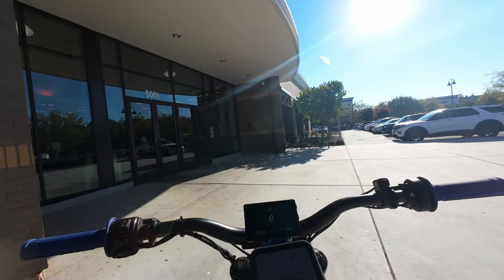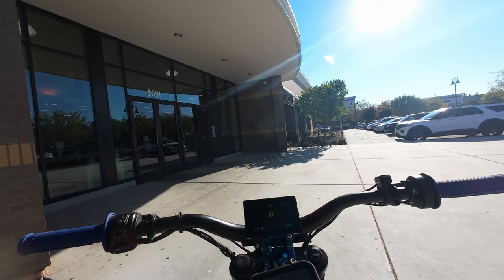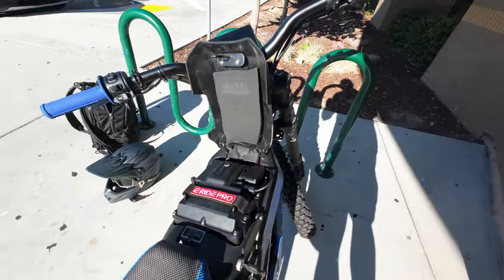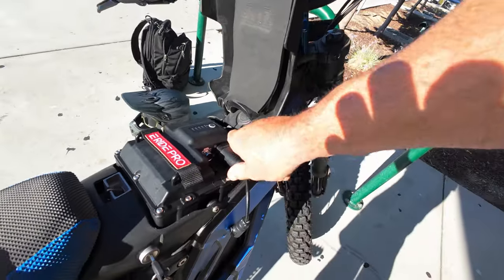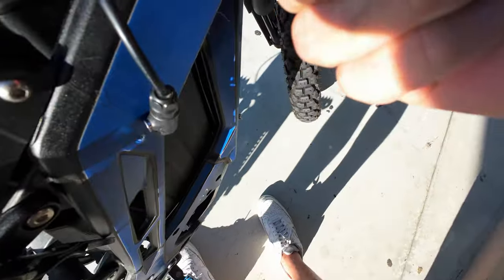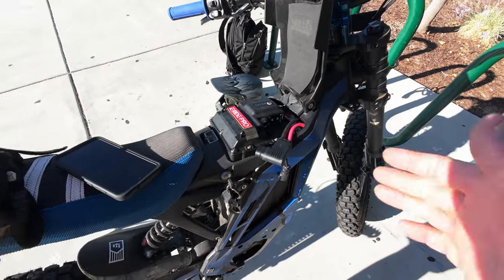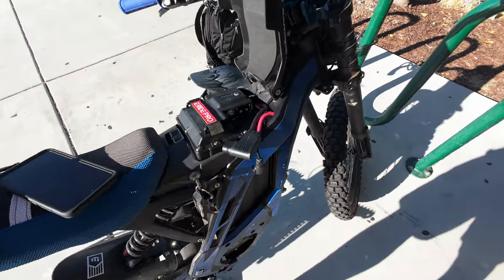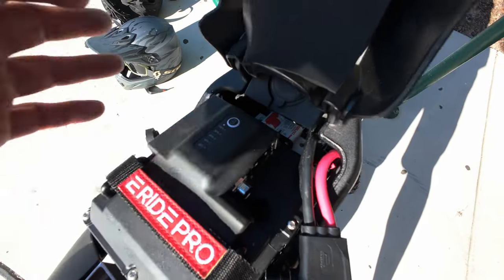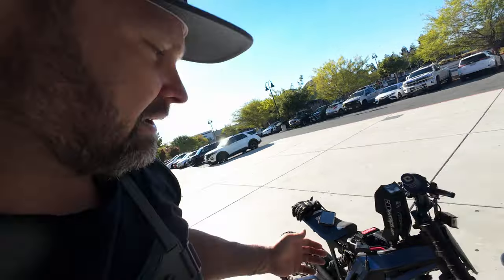Time: 12 minutes 49 seconds for a six-mile commute — not bad. 6.05 miles in 12 minutes and 49 seconds. Now the big question — let's see how the new cables held up. This is the very first ride I've done with them, I threw them right to the fire. Look at how much more robust those connections are. Wow, it's not even hot — I'm touching one of them now and it's not even hot. So it looks like the new revision has helped significantly, because that exact same commute last time melted the old ones. However, when I changed the battery lid, the connector that shows battery life no longer works — but that's because I did it myself. E-ride pro will pay to have a warranty team do it for you, but you have to take it to a shop. For me that's a full-day event as there are no shops close to me.